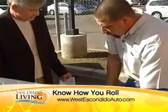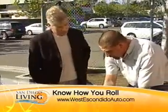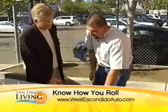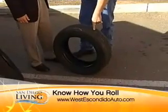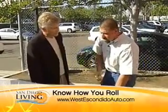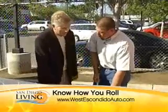These tires, if under-pressurized, wear on the outside and inside stays just fine. What about alignment and rotation? Alignment should be done at least every year or 30,000 miles — you should have your alignment checked. Also, if someone servicing your vehicle sees wear problems with the tires, it's a good idea to get the front end components checked, including suspension stuff, and have the vehicle aligned.